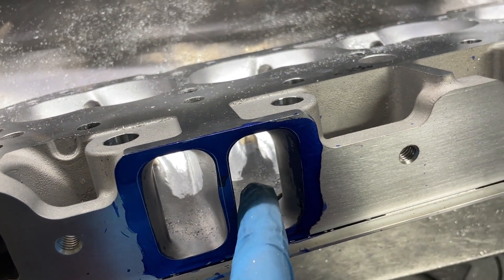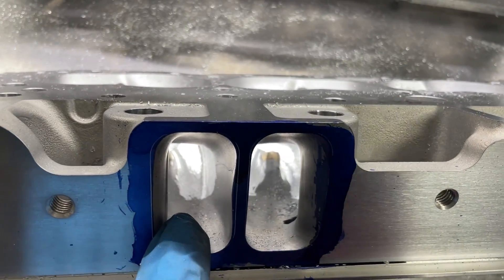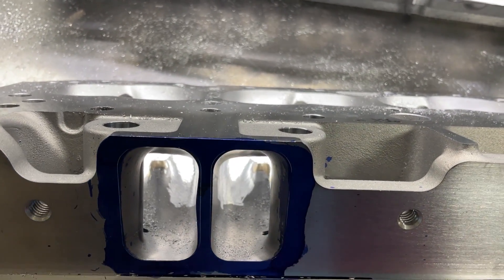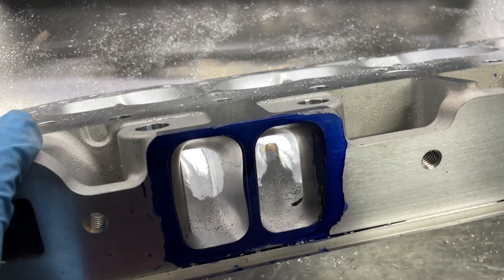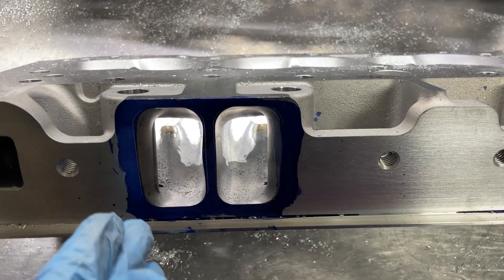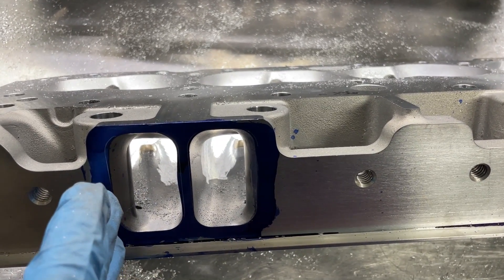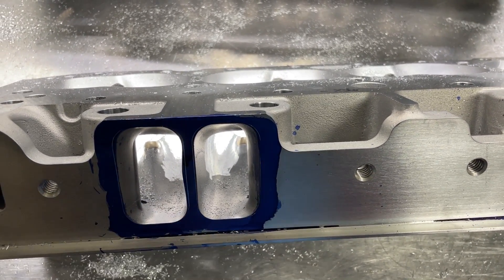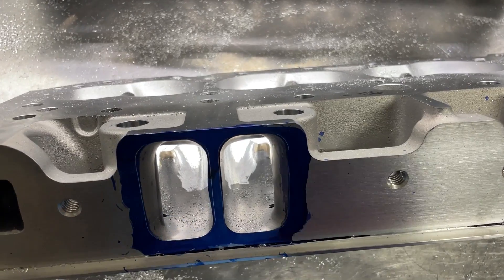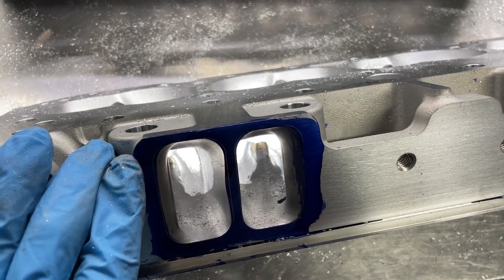I didn't try taking any more out because if you blister it, it's going to be a pain to fix — there's no welding torch that can get down in there. You'd have to machine the whole notch out just to get the welding where you need to be. The point is, if you choose to grind this, be careful right there. Not that they did a bad job casting — this one is pretty good — but just from core shift it got moved over.